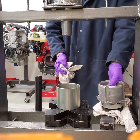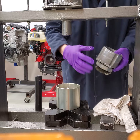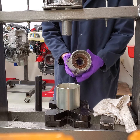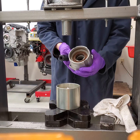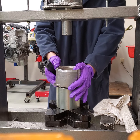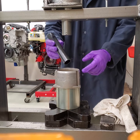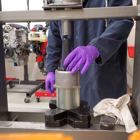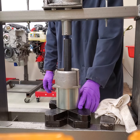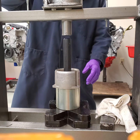I'm going to press this gear off as I showed in the previous video. Put a rag in there. I'm going to take that 266 — last three numbers — put it on the inside and press this gear off. You need the 938 tool and you need the 266 tool. I always use the last three digits to remember the number. I don't need to know all six numbers. Just press it up.